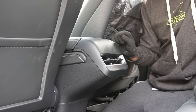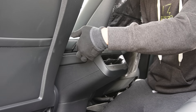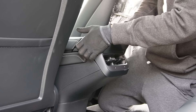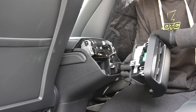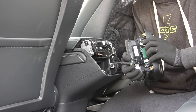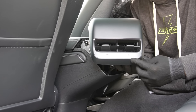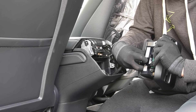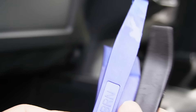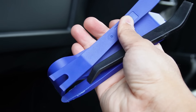First step, we have to remove the rear passenger air vent. There are no screws — there are clips inside. Just grip this part right here and pull it gently, because there is a cable and plug that we have to remove. This is the power plug and cable that powers the two USB-C ports in the back. Just remove those plugs — there's a little clip, just pull it and then remove it. Next step, we have to remove that panel on the bottom. You might need a little help with trim removal tools — I got these from Amazon and I'll put the link in the description.